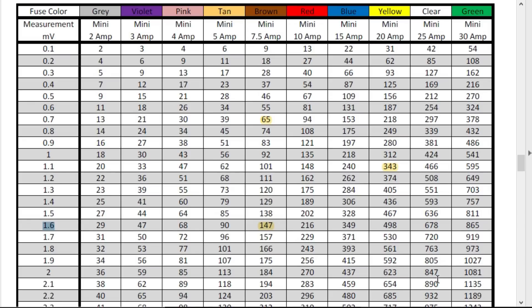If we add all three values together it gives us about 0.6 amps. And if we add the sleep mode value of 0.2 amps as well, that gives us a total of 0.8 amps. When we compare that to the amp clamp value which was 0.9 amps, that's a really close value. The amp clamp isn't going to be the most accurate — the millivolt method is.